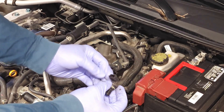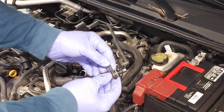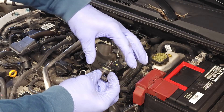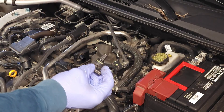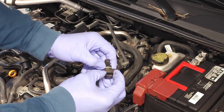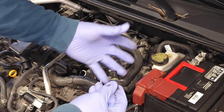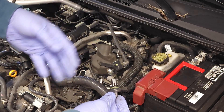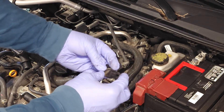It looks in really good shape — nothing wrong with it, it wasn't throwing a code. The condition of the engine oil is very good because you can clearly see the sensor. If the engine oil was extremely dirty, there would be a dark brown to reddish coating on the sensor, which could be enough to prevent signals from being transmitted back to the computer. I'm looking at the O-ring — pressing my thumbnail on it: is it pliable? Yes, it's pliable. If the O-ring was brittle, rock hard, or fell off, you could replace just the O-ring without replacing the entire sensor. They sell O-rings at your local parts store or online — maybe a three to five cent part rather than replacing the whole sensor.